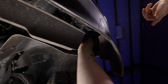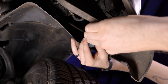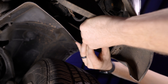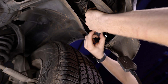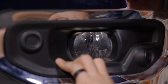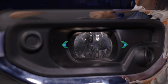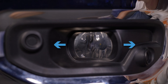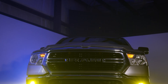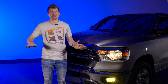Reach your hand up, turn it counterclockwise and remove that halogen bulb. When you pull your halogen bulb down you'll see this red tab — pull it down so you can lower it. Now it should be free and you can pull your bulb out. Plug whatever bulb you choose in and push that tab back on. Grab your bulb, put it in that same slot and turn it clockwise to lock it in place. When installing, make sure the LED chips are facing left and right — horizontal — to give you that perfect beam pattern. Once done, zip tie all that wiring so the driver isn't dangling, then do the same for the other side and your install is complete.